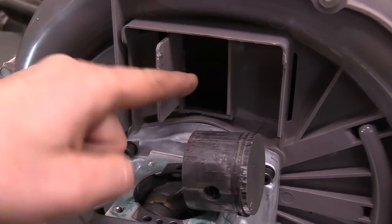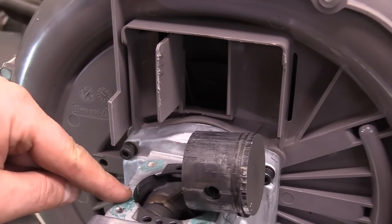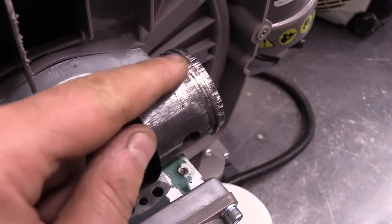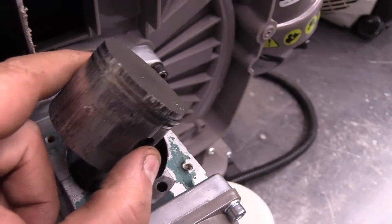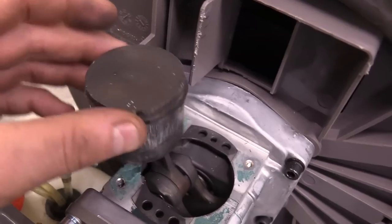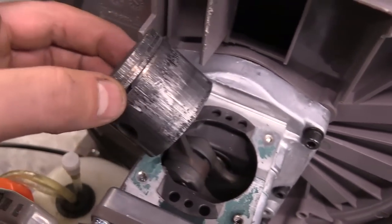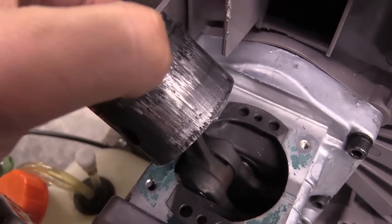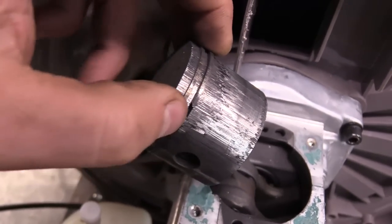I think this hole here blows air to actually cool the engine. Wow, this is super super bad — and it's really bad on the intake as well as the exhaust. Wow, one ring is loose and the one at the bottom is stuck.